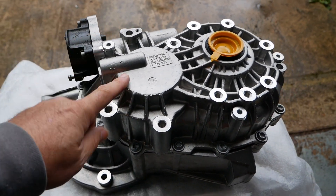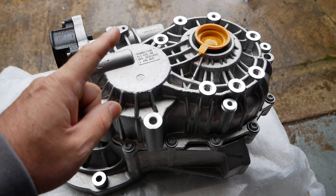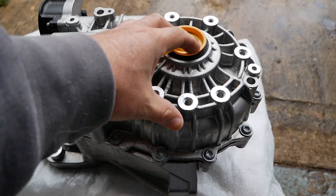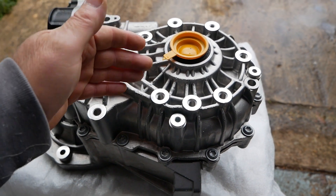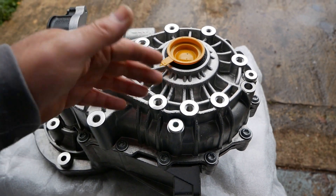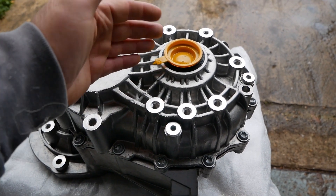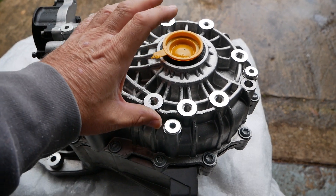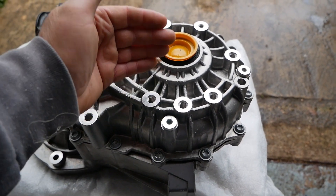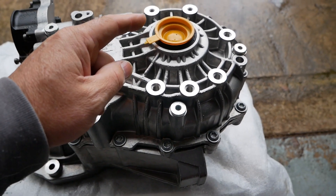It was an expensive job — we just needed that little actuator but had to buy this whole new gearbox. These are about £1,500 plus VAT, so an awful lot of money just to get one component they could sell separately. Anyway, while I've got the motor here, I thought I'd make a video because I do get asked about oil changes on these. The reduction gear oil — if you listen to the manufacturer — is sealed for life and you don't need to change it. However, it is wise to change it, because what we're finding on other EVs is the reduction gearbox tends to be a bit of a weak link in the EV powertrain, purely because of the torque put on these gearboxes.